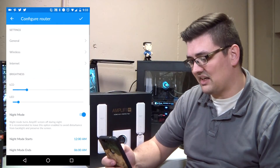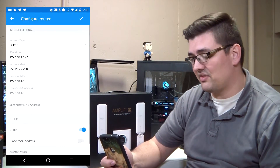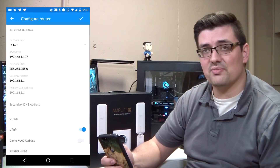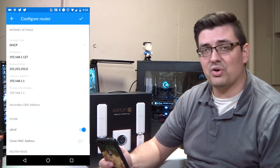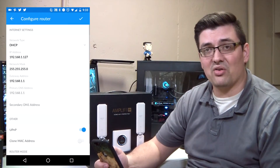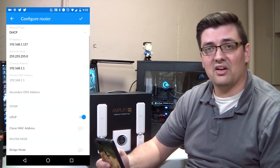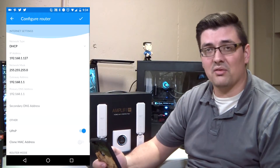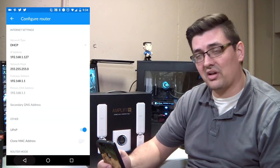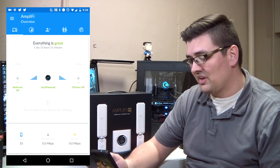On the internet side, you can set a static IP on the WAN side of the router if your ISP has given you one, or if you're placing this router behind a modem or an ISP's router. You can configure static IPs on both the internal and external sides, and also set up a DMZ — a demilitarized zone — for more advanced network configuration.